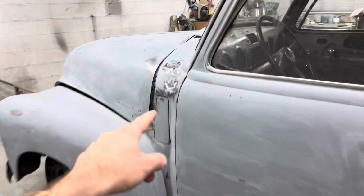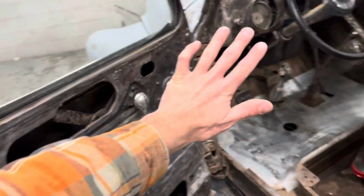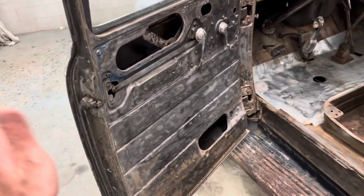And on the inside, so my sealer that I'm using is, my mind's gone blank. Think. Epoxy. I'm using epoxy primer that's reduced down a little bit as a sealer. So I'll put that on first to cover up all these bare metal spots, because I don't want to just put paint over the bare metal. Even as cheap as we're doing this, I don't want to put paint right over all this bare metal. You need some epoxy primer in there to seal everything off. So we'll do epoxy primer first on the whole thing.